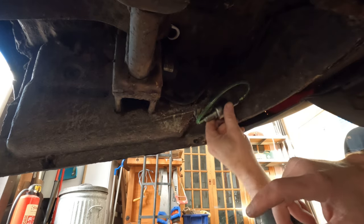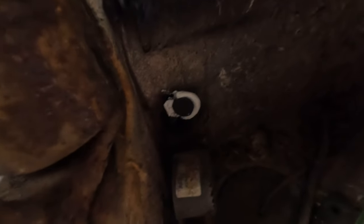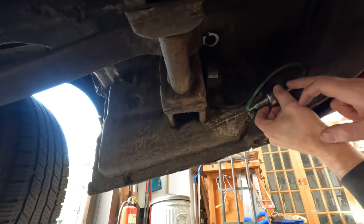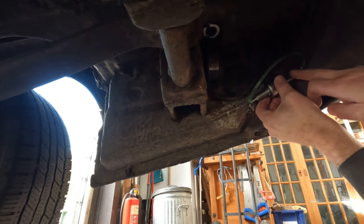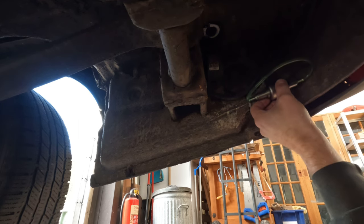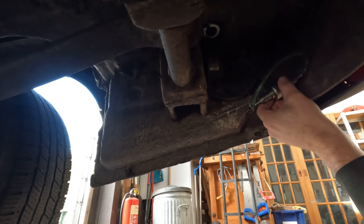So I'm going to put the fuel pump under here. See that grommet there with the sealer in it — that is where the fuel line will come through. The pump will come here. There is already a hole for some electrics up here, which I'll use for the electrics for the fuel pump. But I've got my rivnut gun, so I'm going to drill, fit a rivnut, and bolt that to the van here.